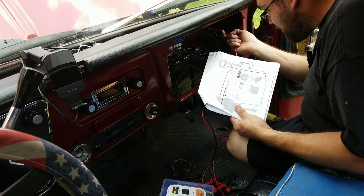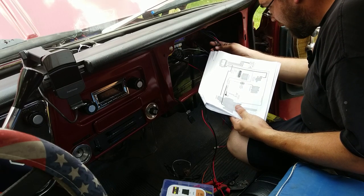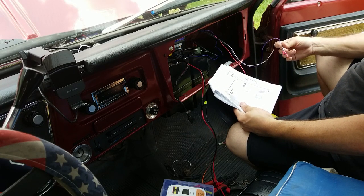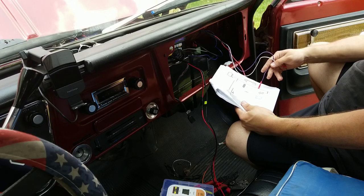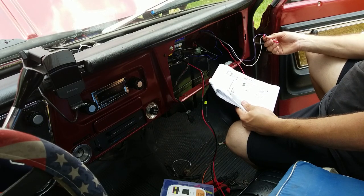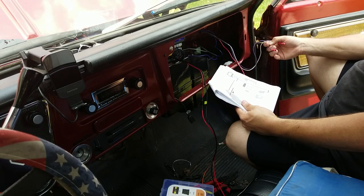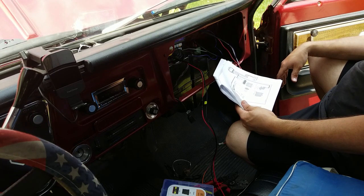And then these reds are split. And then the blue is the trigger wire, apparently. So the ECU sends power on, this switch determines if it actually goes, and then white and purple send power to your AC. So purple must be like a fan kick or something like that. So I could use this purple wire to tell my Terminator that the AC is on, instead of using a trinary switch to do that. You can just do it with a normal binary switch and just tell it you have 12 volt input to let you know the AC's on. It's not great to do 12 in when you could do ground, but it's already done. And I can return the trinary switch I bought.